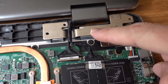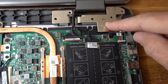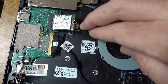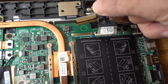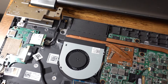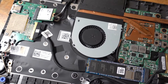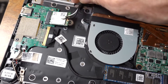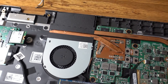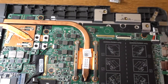Alright, here's what we're going to do: take these screws off, fold the lid all the way out, move the last two screws out of the hinges, and remove the Wi-Fi antenna cables. Undid both of those — now we're just going to pick this up and separate it. The Wi-Fi cable has tape holding it on — come on, Dell. Okay, there it goes. Totally separated the monitor from the case now.